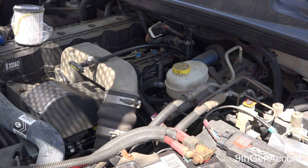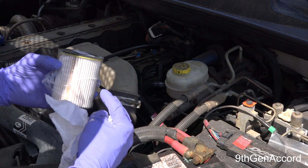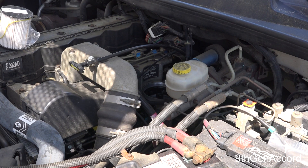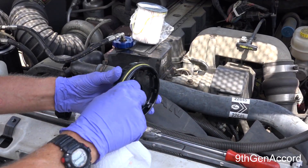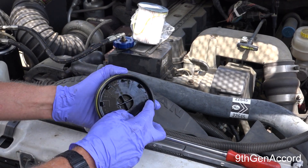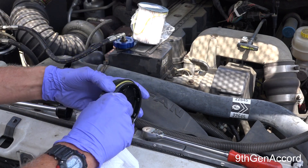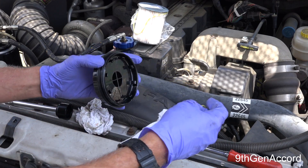It's not a lot of debris. The way this works is that fuel flow goes from the outside to the inside and then to the injection pump — so that is the dirty side. But if there's a lot of debris in there, go ahead and remove it. I've got the filter cap with the old filter removed. These teeth grip onto the outer top portion, and I'm just going to take my fingernail and remove the O-ring. Always replace the O-ring when doing this job.